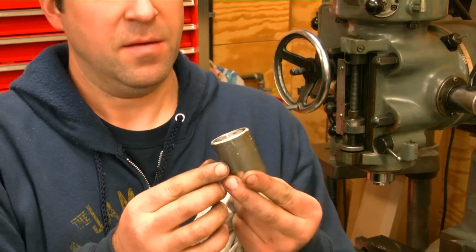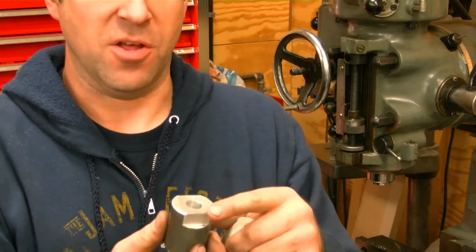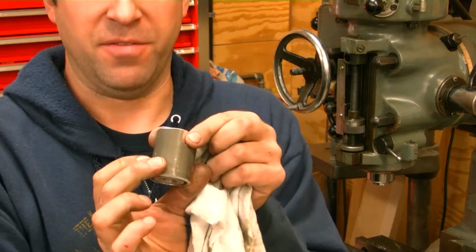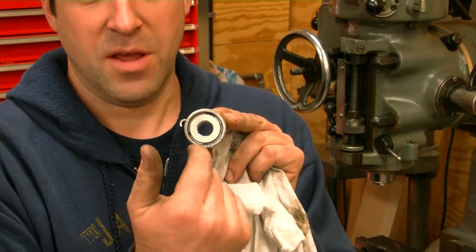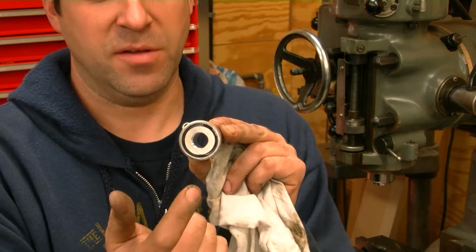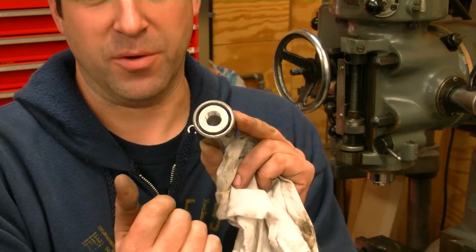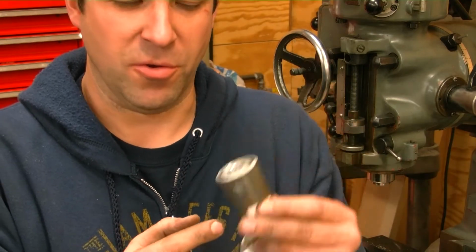Alright, got my oil pressure fitting bung almost done. This was a solid piece of bar stock. I milled off the edges so I could clamp it in the vise. Then I took a 1 1/4 inch hole saw, drilled down through it. Then I used a 9/16 drill and then a 16 by 1.5 tap for the oil pressure sensor. Now I just got to cut it off around there. I figured I'd spare the details of showing you all that.